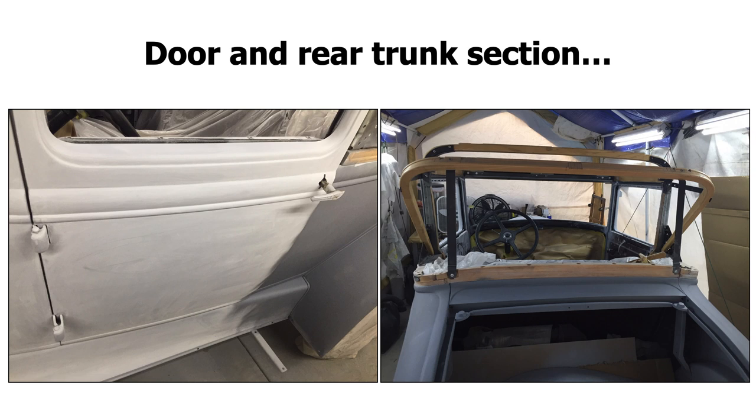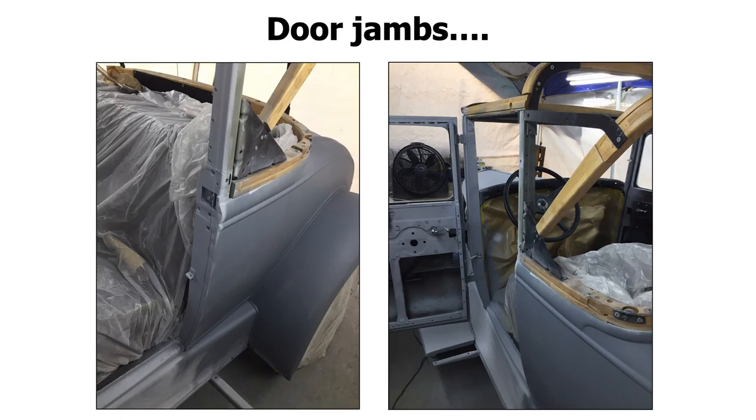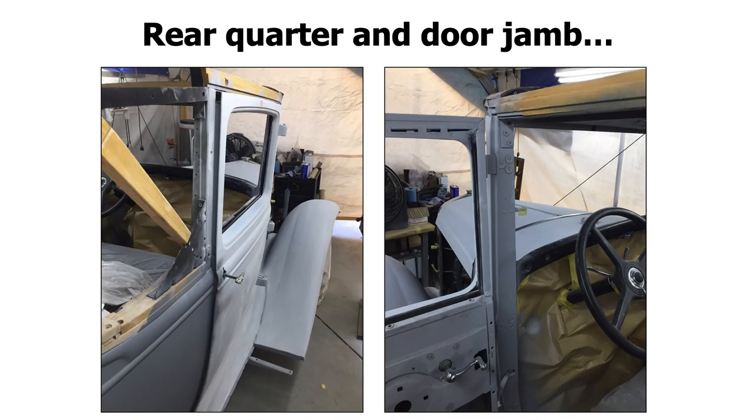I would actually tackle this thing at one shot. If you feel like you can do it and get everything prepped up, I would definitely whack this thing in one whole time — do all the jams first, then close the doors and rock the outside two coats across the whole thing. It's going to take you a little longer when actually painting a complete paint job like this with door jams. So I'll give you some timeframes — actually I didn't consider doing door jams, I was just considering just an outer body paint job. You can see part of the door jam, the rear quarter panel, and some of the wood frame here where the soft top goes onto.